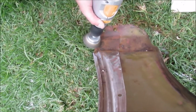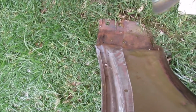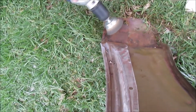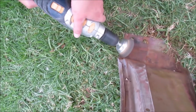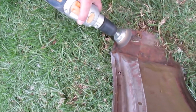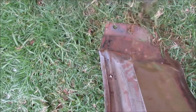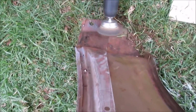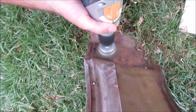The fact that those holes are forming is a good thing, because you don't want full bits of rust. Anywhere where the rust is going right through, we have to turn into a hole. Otherwise the rust will come back, you know? Yeah. Gotta get rid of that cancer.